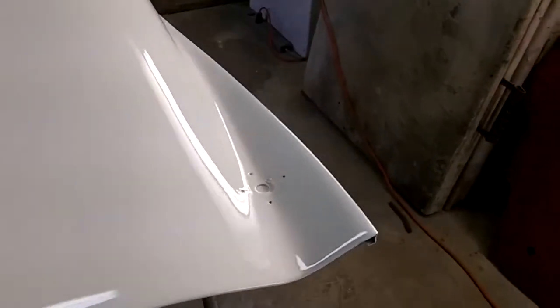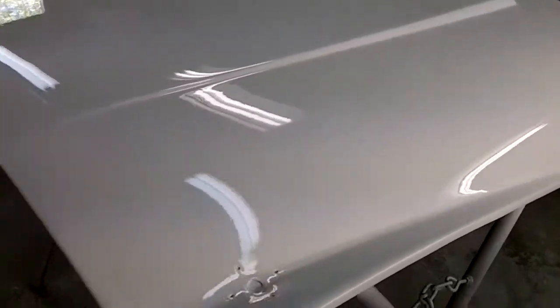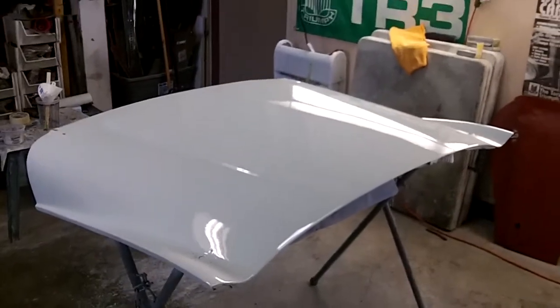No runs that I can see. No sags in the clear. Little dust bunny. Little bit of dirt in it, but not too bad. Overall, I think I'm going to be pretty happy with it. There will be some sanding required. I was really concerned about these edges and everything sort of flowing off, especially when you get to the clear. I know when I sprayed primer initially on this hood, I was having problems with the primer kind of running off the edge — I guess I was coating it too thickly. Anyway, it looks pretty good. I'm going to let it sit for a little while longer before I attempt to move it. I'd like to let it dry for another couple hours and then maybe get it out of the garage outside in the sun so I can get in the garage and work on something else. Yeah, all in all, it looks pretty good. So there's the first complete panel painted for the TR-3A — a bit of a milestone.